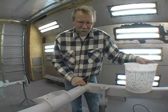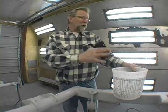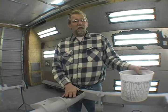And we can sand the whole car like this, and it would be just fine. We could dry sand the car with the DA, especially on the flat open spots. It's a little bit quicker. We could dry sand around the corners if that's what you'd want to do. Personally, I like the wet sand. So we'll dry sand the big areas, I'll wet sand it all, and I'm gonna get this to 600, and then we're gonna be ready to paint it.